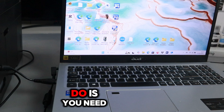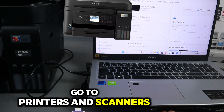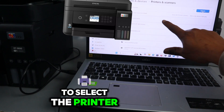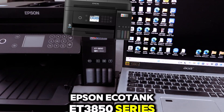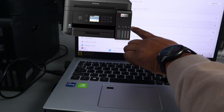Now, go to your laptop settings, go to Printers and Scanners, then select Add Device. The next thing to do is select the printer — look for Epson ET-3850 Series and select it. It shows us the option to print a test page.